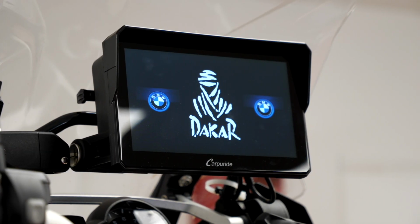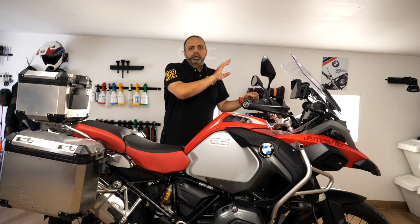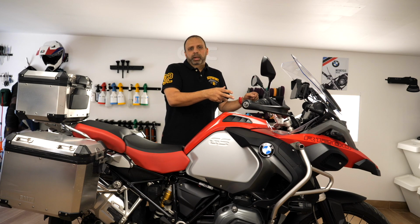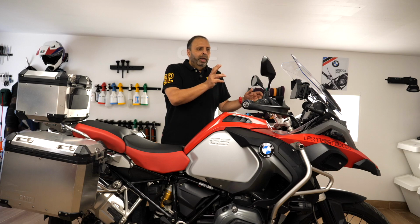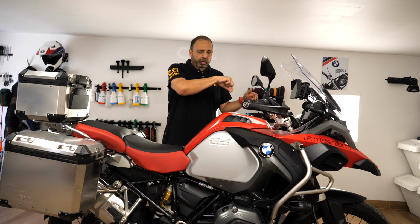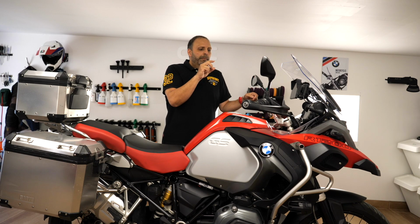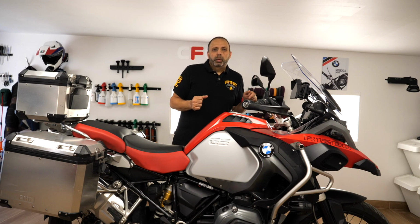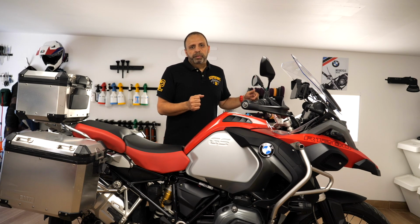The only thing left to do is put the cover back on. Now when you put the cover back on, take this off the bike, go sit down and do it at a table or a desk or whatever. Take your time, as I said, because you do not want to drop the screws, and you will be dropping them the first couple of times because they're so tiny and you're trying to get them back in. Best not do it standing around the bike, or if you lose one, you're going to be in a world of pain trying to find a new one for the unit.